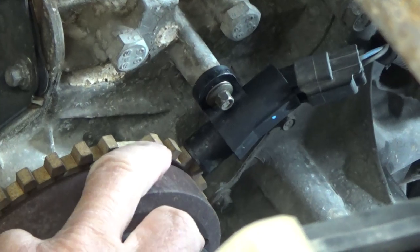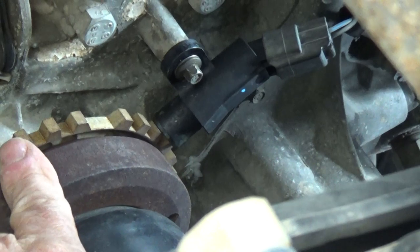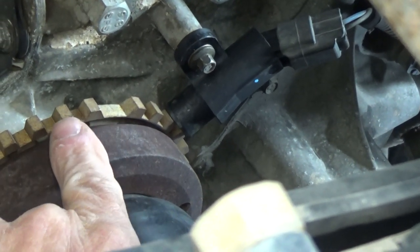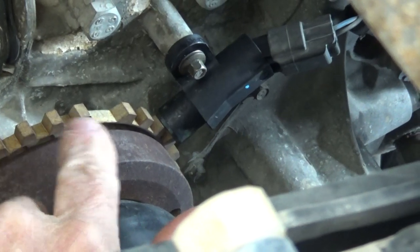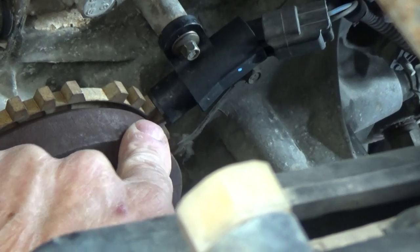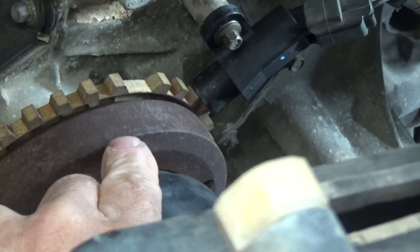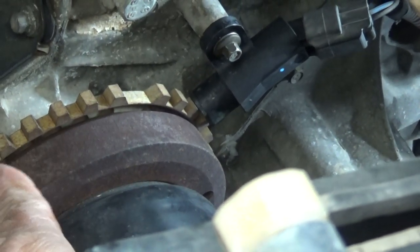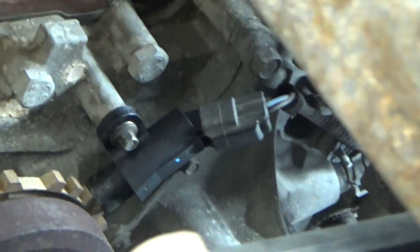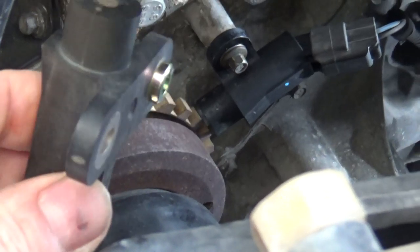But in my case it's on the outside of the motor. This is the thing on the pulley that spins around, and each one of these teeth here will attract that magnetic field — pull on it, send the signal to the computer. That's pretty quick because this thing is turning at engine speed. Look at how many of them are on there going all the way around.